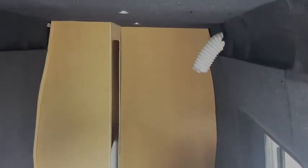That's not a bad template to say, I just copied it off the opposite wall. I've got that fairly tidy coming up there, recessing in, lovely. This side's obviously a bit slack because none of these walls are fixed at the minute, so obviously once that's screwed and pulled in tight, that's going to give this wall a lot more strength, and obviously they're going to pull each other and make a nice tight fit. If I can get back far enough. No more back doors in the van. One bathroom, two dog crates and a drying room. So I've now got to take this one back out and cut the holes for the dog crates.